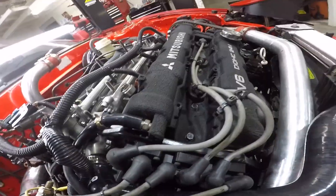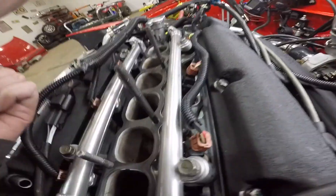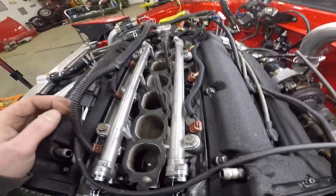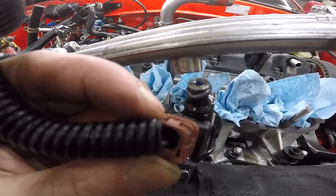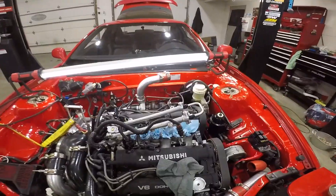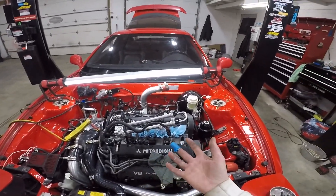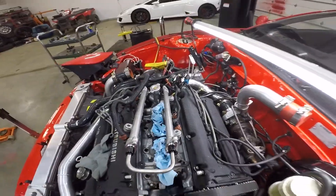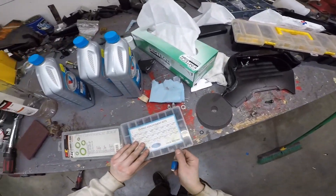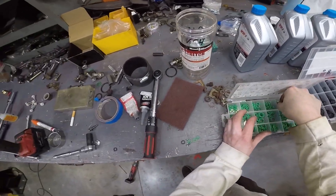I hear fuel coming from somewhere — it's leaking right there. Two of these fuel injectors are leaking. This one and this one are leaking off the top. I gotta take this all apart. The O-ring that goes on the top got crushed all weird — I gotta replace it. I'm gonna check them all now. You know what feels really good? Getting fuel in your cut. You're sitting here thinking everything's gonna go smooth and then something sprays fuel right into your cut. Let me go over these and replace these O-rings. I have a billion O-rings and I'm almost guaranteed I don't have this size.